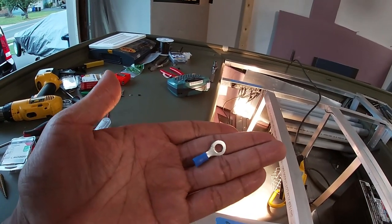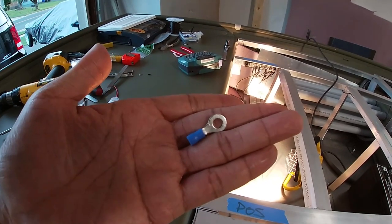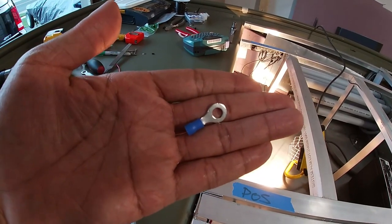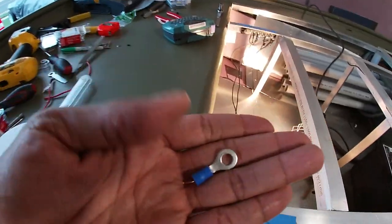It looks like a regular circle or ring terminal connector, but this actually fits a 1/4 size stud down to a 14 gauge wire. It took me a while to find these, but I eventually found them on Amazon. I'll leave a link in the description below.